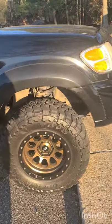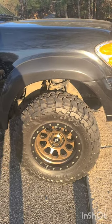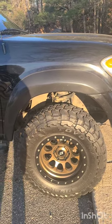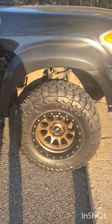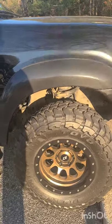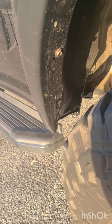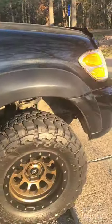With the three inch lift up front — it's sagging now, which will be part of the next video — it's a three inch puck spacer up front for right now with SPC upper control arms. You can clear 17 by 9 negative 38 millimeter offset with a 33 1250 R17 tire absolutely no problem, as long as you're willing to do some trimming in the back. Trim that pinch weld completely flat. I had already trimmed a little bit of my fender flare off for the 20 by 12s, so I just cleaned it all up this time. Full crank reverse, full crank forward — no problem, didn't have to touch anything up front.